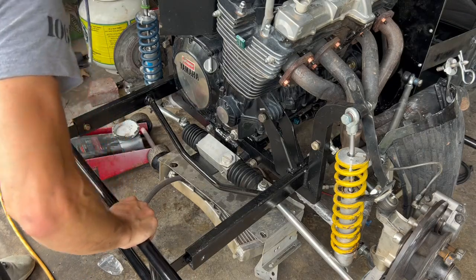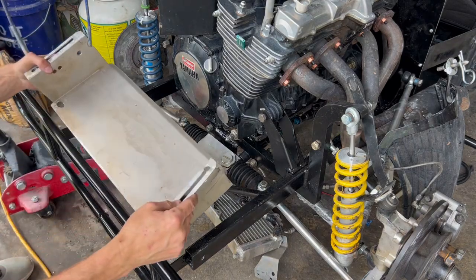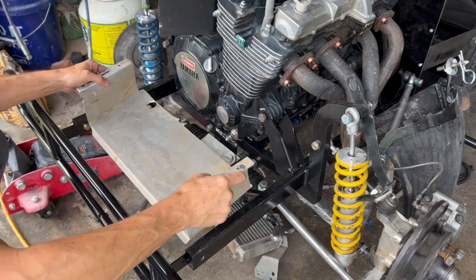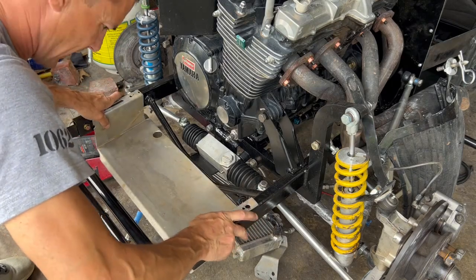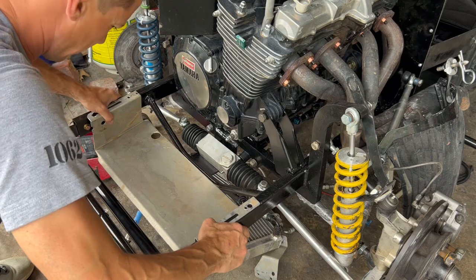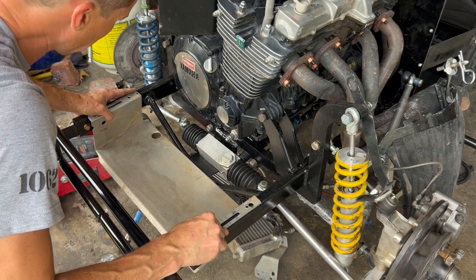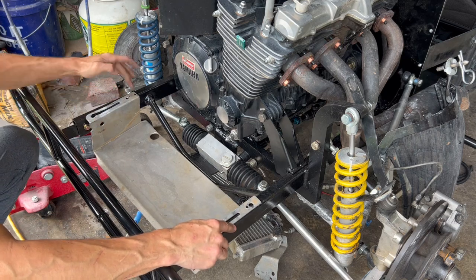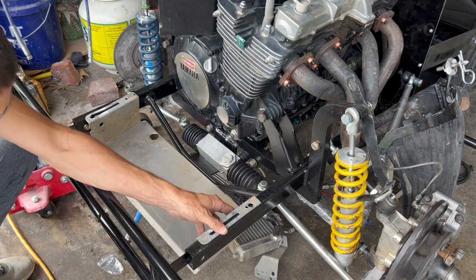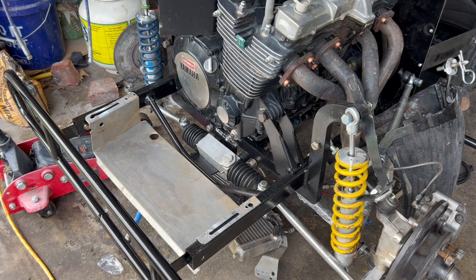And where did my, up there. So now, goes this way. Now we gotta get this thing reinstalled in here. I'm gonna do this side first because it's straight. This side's a little bent from the accident, so I can put this on, then grab the vice grips and drill my holes from over there. So I'm gonna mark out on my frame rail where I need to drill my holes. And I can find the marker.